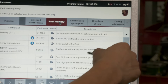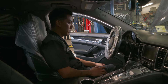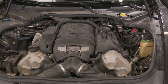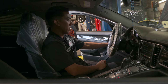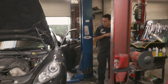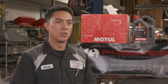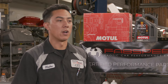There are our fault codes for the high-pressure fuel pump — we're going to go ahead and delete those. This car started up. It took a second to fire right up only because there was no fuel in the system — it just had to purge. If I were to shut it off, it should fire right up. Compared to before, it would just crank and crank before it would start. Any time you're messing with fuel, you want to make sure you don't have any fuel leaks. Once you have everything tightened up, double check, then do a proper test drive and make sure you don't have any other symptoms.